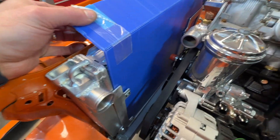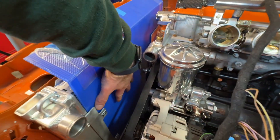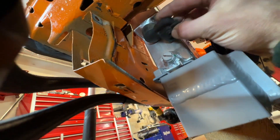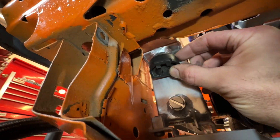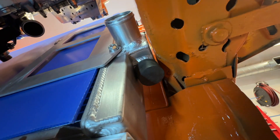Let's take a look — definitely pretty tight in there for a fan. I'm thinking that this can actually be removed, which might afford me a little bit more room than I thought. The fan might end up living right in here. Now let's see where our mounts are going to go — this is one right here, so we've got one there, and it's going to have one of these guys sitting like that. I just need to make a bracket that allows it to sit in that exact location, and the same thing on the other side. Once we get these two brackets installed, I think we'll be in good shape to start routing our lines.